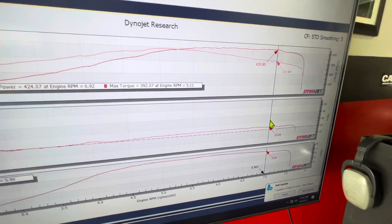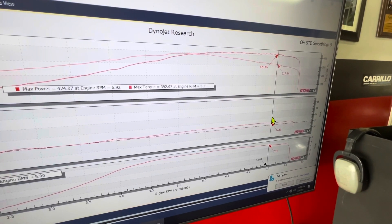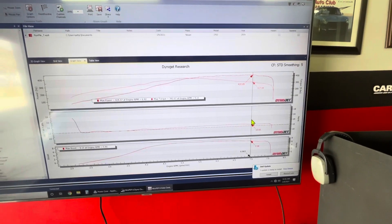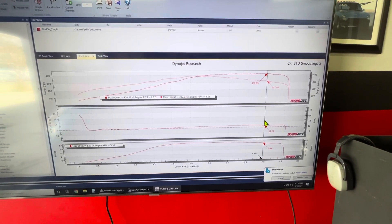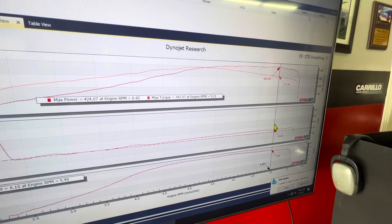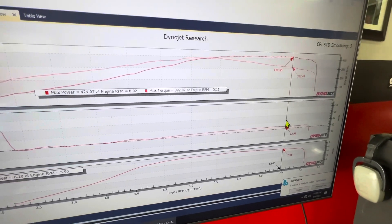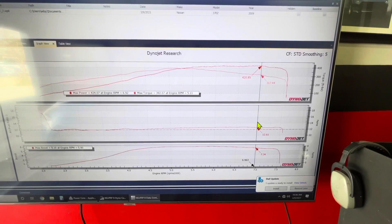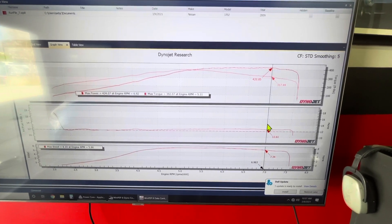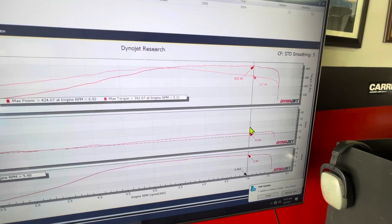But you have two other independent sensors that are showing the same lean mixture at the top. This is why, if you have me remote tune your car, I always ask that you have an aftermarket wideband setup so we can reference it to make sure the factory sensor is reading correctly, and we can ensure that we're not running too rich or too lean. So on the next video what we're going to do is richen it up, and you'll see what happens to the readings on all three again.